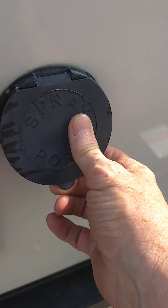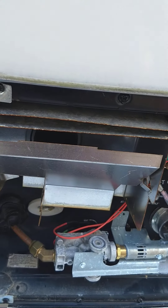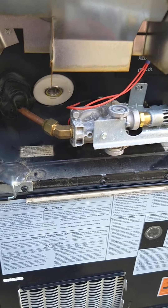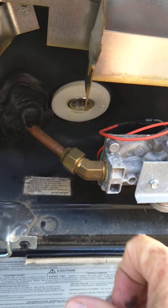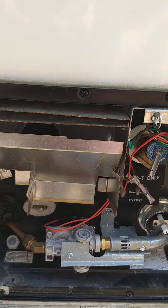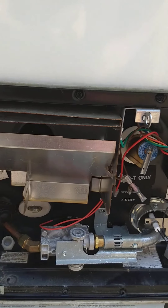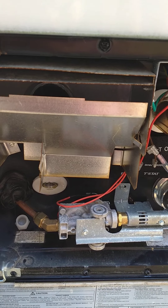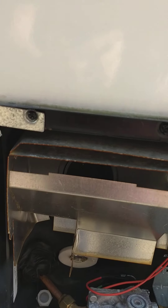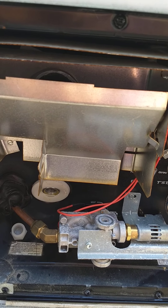This is your water heater. First of all, this is the spray port — I showed you the blue coiled sprayer that fits right out of there. This is empty at this point; you drain it with this plug right here — it comes right out. The reason you would drain it is because if you leave water in there for months with the hot sun, it'll start to get brackish and smell like rotten eggs. So it's good to drain it when you're not camping with it. This runs on both gas and electric; the switches are inside.